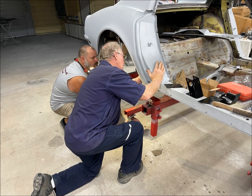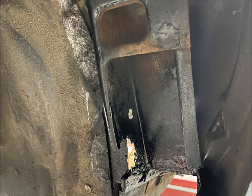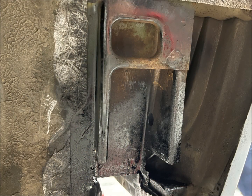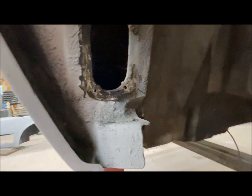These are a few pics of where the front clip was glued on. The most difficult portion is right across the top under that cowl — just be really careful there. Here is Cecil and Jason looking at the rear birdcage damage. This is where the frame connects to the body behind the seats and door jamb. This area is visible through the wheel well and should be inspected, theoretically, prior to purchasing a C3.